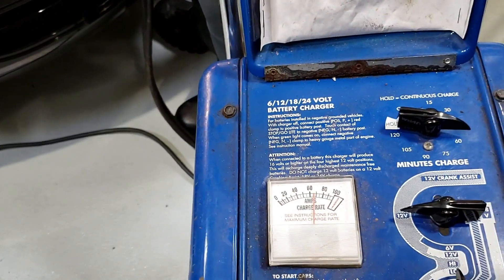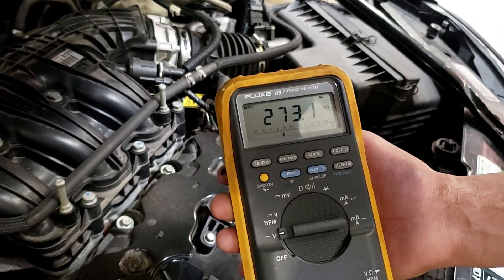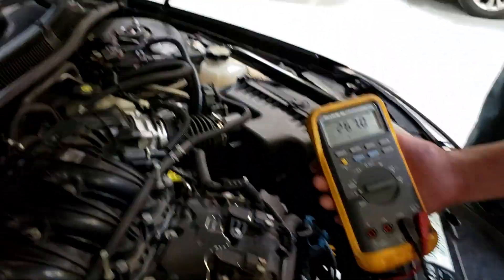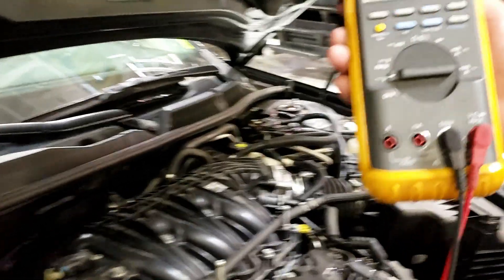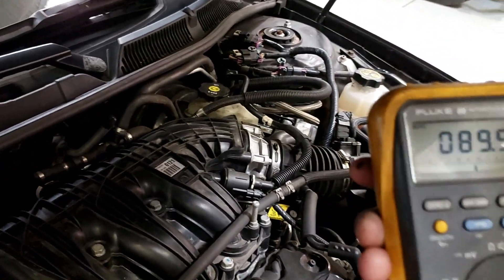On 12 volts — look at our AC voltage: 271 millivolts, connected to the battery. Is that good or bad? What was the maximum we should be doing as a battery maintainer? 200 millivolts. We're on 12 volts now and we're down to 80-something millivolts.